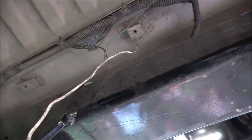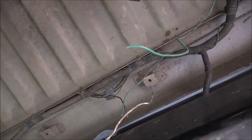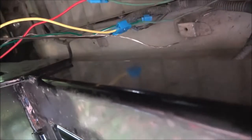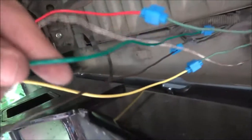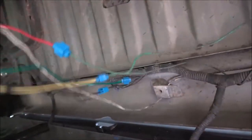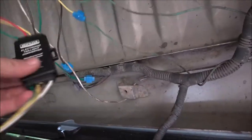There's the right turn signal and the left turn signal. I'm going to get these hooked up and show you how I do that. I'm just going to use these scotch locks right here - these are cold scotch locks - and I'm going to go ahead and tape them up. I haven't had any issues with them, but I'll tape them up anyway. Here's our brake light, left turn, and right turn - all going to be put up in here, nice and neat.